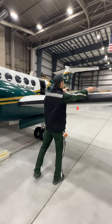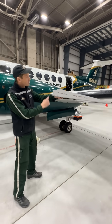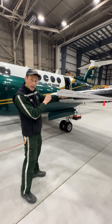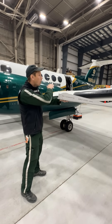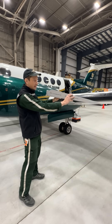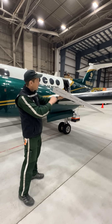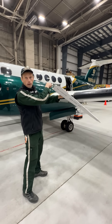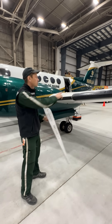I'll give you a dirty example. This is the ice-contaminated airfoil. You can see that some supercooled droplets have hit the wing and accumulated into some knobby, rough ice shapes all along the leading edge. If you imagine this airfoil slowing down and tipping upward with respect to the relative wind, the airflow right here is going to separate — it's going to burble. That's an aerodynamic stall. We need to prevent that, and that's why we have the boots.